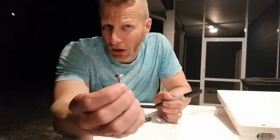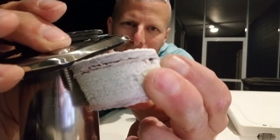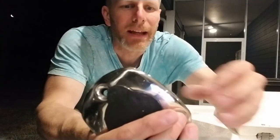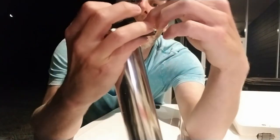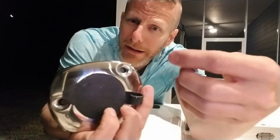Then drill a pilot hole - take a drill bit that's slightly smaller than the screw so it doesn't crack your fiberglass. I can see that if I wanted that screw to bite down through the fiberglass, it needs to be about twice as long. Even though these screws came with the kit, I'm going to go to a hardware store and get the same size but about twice as long, with an angled head instead of flat, because these holes are angled. Sometimes the screws that come with a product aren't the best for the job. That's about all we can do tonight.